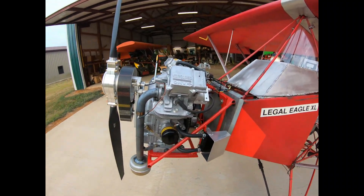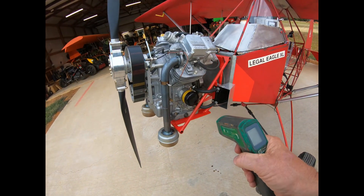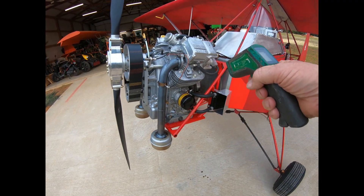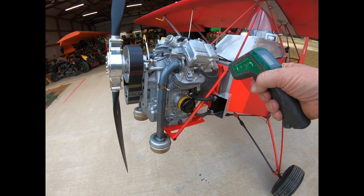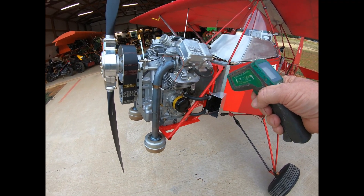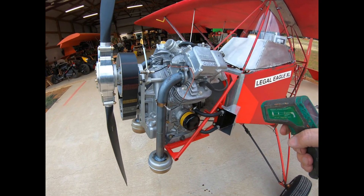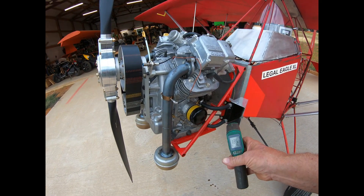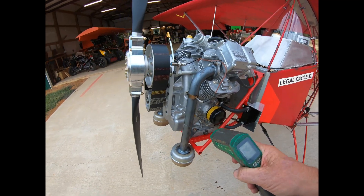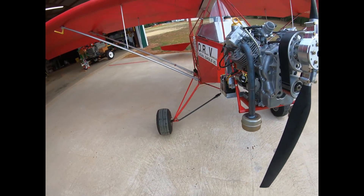The oil temperatures — I do not have an oil temperature gauge in the airplane. By shooting the temperature, the bottom of the crankcase is 149. The bottom of the oil filter is about 190, and it's about 178 at the oil filter. Back here at the oil cooler, I'm seeing about 135. So I don't foresee any real problems there, because once you're moving through the air, you'll get a lot more airflow over there.